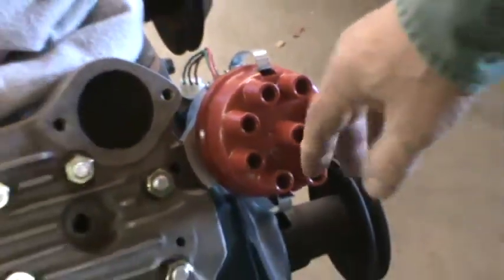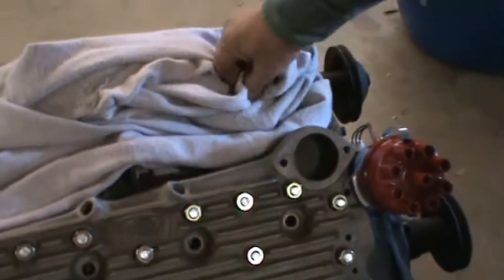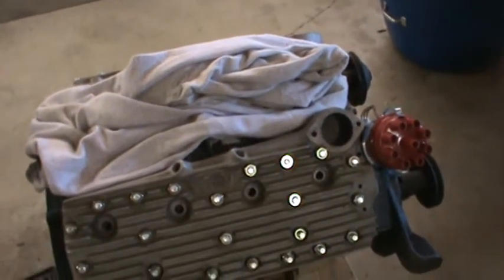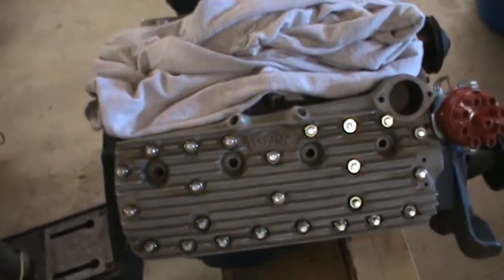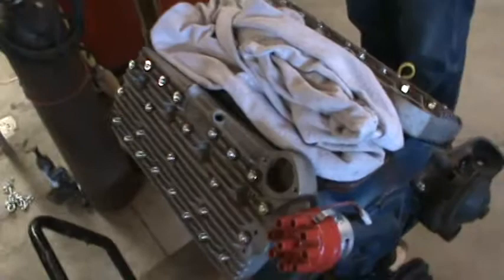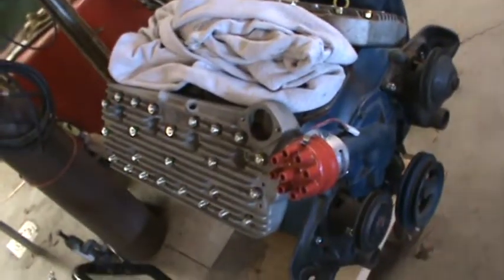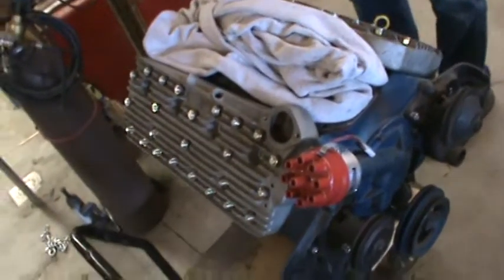We're going to mount plug wires on this. We'll be 4 going this side, 4 going on the other side. That pretty much completes that. What we need now are my flywheel back, which I sent out to get it trued. We bought a 10-inch Mustang clutch and pressure plate, a diaphragm pressure plate. That's getting drilled for that and balanced, and the tail shaft bushing and the 4-speed. Now we're going to put it all back together again.